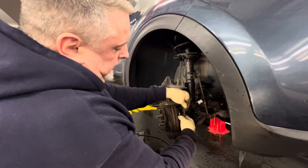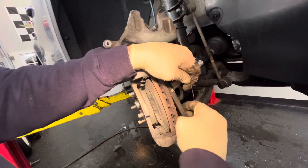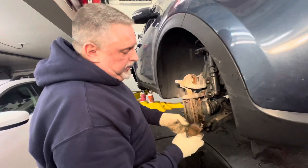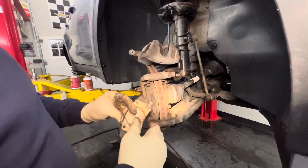This bracket has little retaining spring clips that are pushing the pads out. They clip into the little hole and try to spread the brakes — they're working because they force the brake pad out. The brake pad that has the tab on it for the wear bar is on the inside on the top, and that's the same on both wheels.